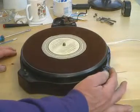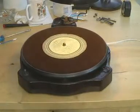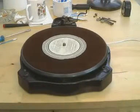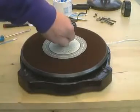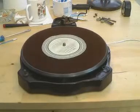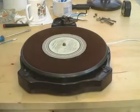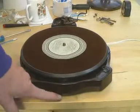It is rotating at 78 RPM. The strobe is rather hard to see because it's bright daylight, but it's at the slow end, so we need to just adjust the linkage underneath. But there we have a very nice deck, and there's quite a fair amount of torque in it. It's suddenly dawned on me — this is the only surface-mounting record deck I've ever seen. All other record decks require a hole cut out in a board and you drop them through, but this one mounts on top.